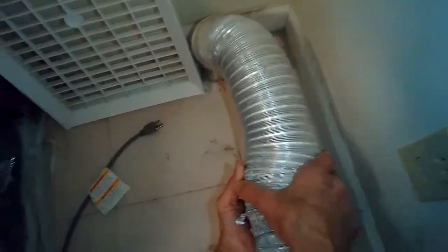And this is just on the gas LG dryers, but right inside here you'll see a small switch with two red wires coming into it, and in between those wires is a black button. And I'm going to reach in and press that button. If you feel it click, then that means you just reset that thermal switch. If it doesn't click, then there's something else causing your dryer not to heat. But this is pretty common.